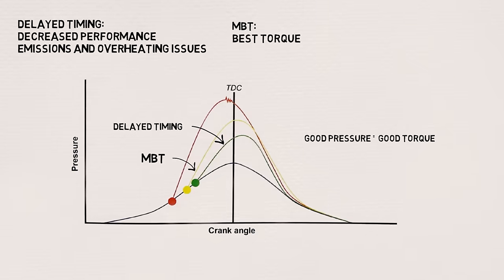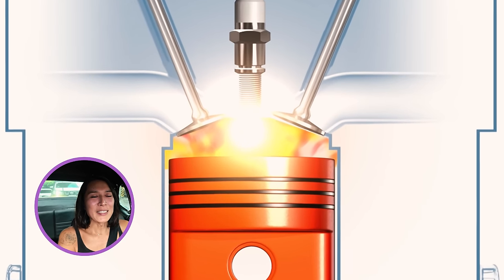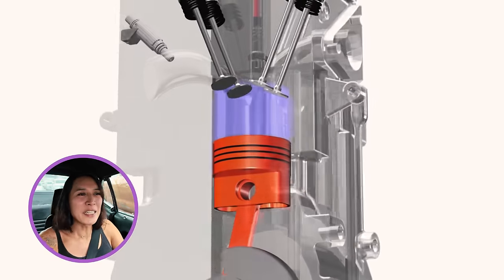So sometimes tuners will put safety protocols so that when the temperature, or what they call the IAT, intake air temperature, exceeds a certain value, it pulls timing from the motor. Now, when you pull timing from the motor, you're basically reducing how much spark advance is being given. So normally, from a ones and zeros perspective, when you're at top dead center, which is zero, you have spark there, but you're not going to make power because that means you're at the top of the stroke. When you're at the top of the stroke, you don't have the rebound effect. So what they do is spark advance. Before the piston hits the top of the stroke, or the end of where the connecting rod and the crankshaft meet, you basically want to spark before that, so that there's an actual compression of the gas.